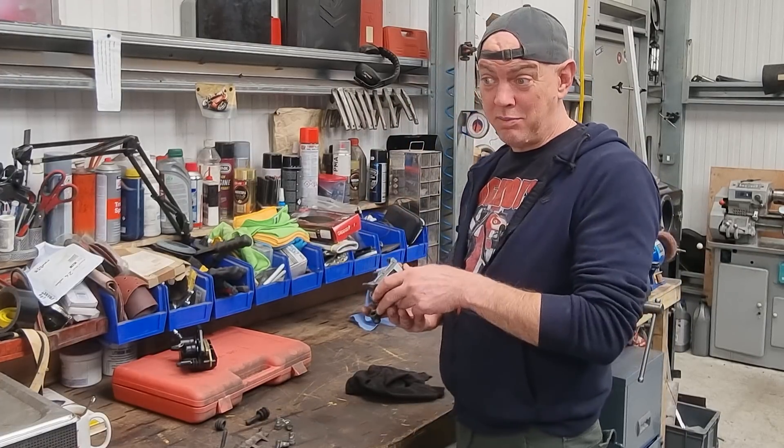So that's those two done, once I get my spacers. I've got all my banjos sorted, I've got my braided lines up there, so then it's literally just a case of sticking it all together and bleeding it. I do need to get another 7mm bleed nipple for this caliper because it hasn't got one and neither have I. So I'll have to get that sorted. I think just bleed it up and it should be good - stick a lever on it, that'll help.